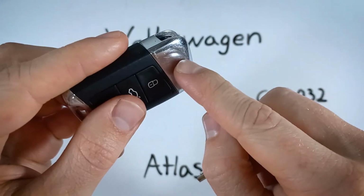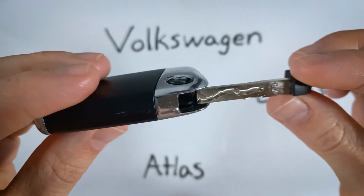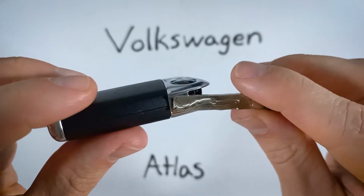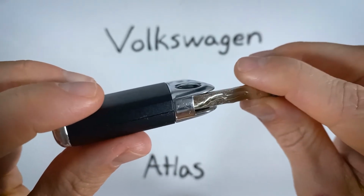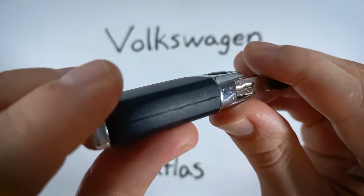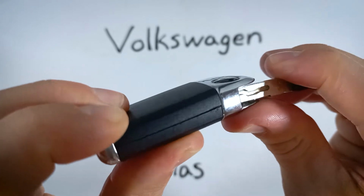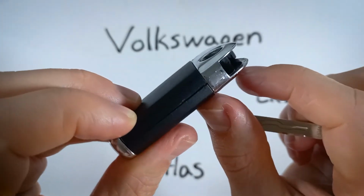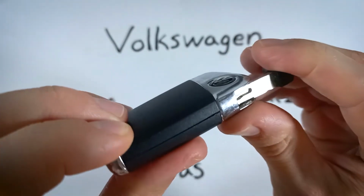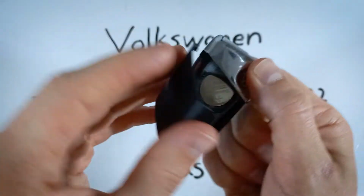If you have the full plastic version, the black plastic up on the top, you're actually going to be able to use this key itself to do this process. It'll be pretty easy. You just insert it in past where this metal would be into about here, or where your top piece would be, and then you'll just push back. And as you can see, as I push back, this will start to open slightly, but because the metal here is not bending at all, it's kind of different. So if you have the plastic version, you'll just pop that in there and pry. As you can see, it just popped out a little bit. So you can actually do this with the metal version as well.